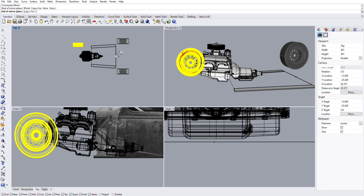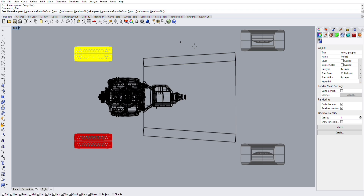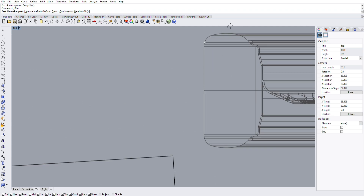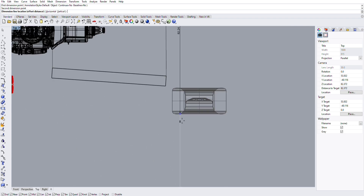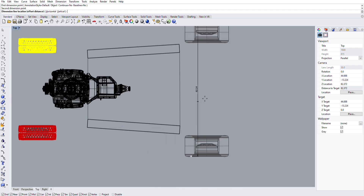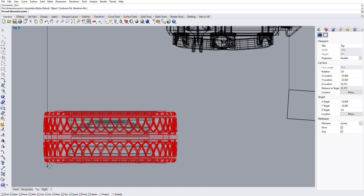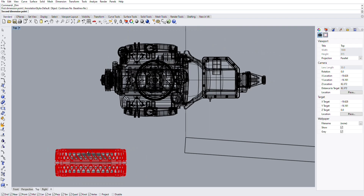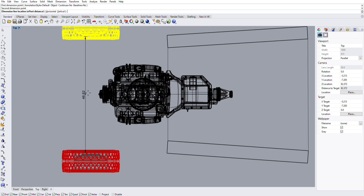In real life I've made these out of cardboard and bolted them to the side of the car to see what I'm doing. This is a little more accurate — I can actually check clearances here pretty easily. The outside of the car is going to be about 82 inches — in the ballpark of seven feet. It's wide but it's not ridiculous. Up front, the way I have those tires sitting, there's probably a little too much stagger. I'm probably going to end up running a beam axle up front somewhere between 44 and 48 inches wide at the kingpin.